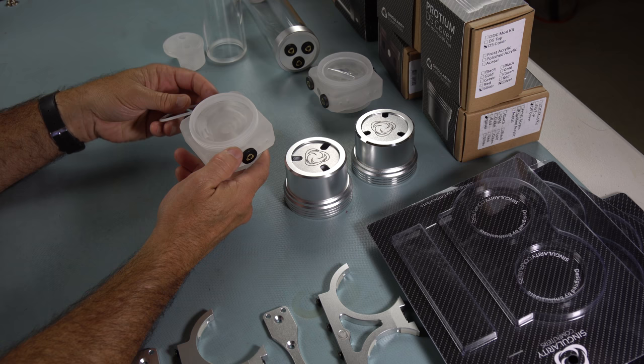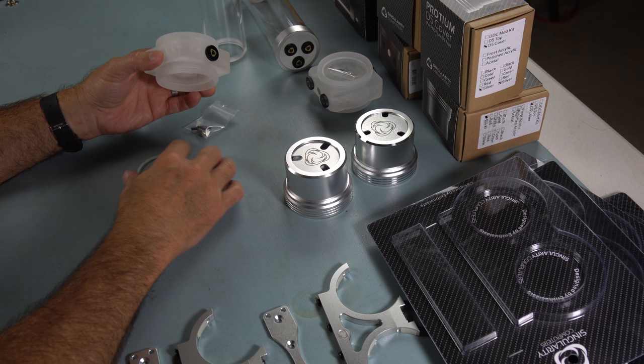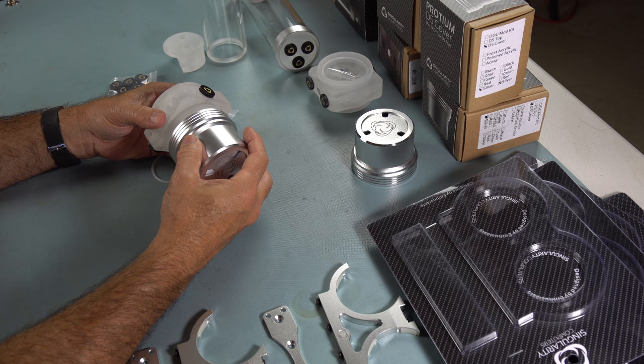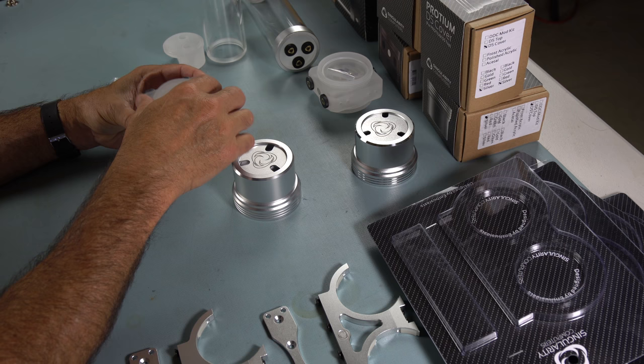It has three plugs on it. Of course you're going to be using at least one, and this is designed so that once you mount your pump, that'll be mounted inside of here through the cover. You could have it situated somewhere and tubing or fittings run to this, but I'm going to remove this. It's not needed when you do a reservoir mount. So you unscrew this.